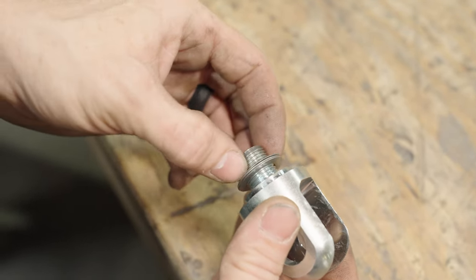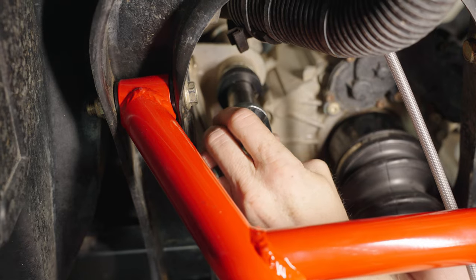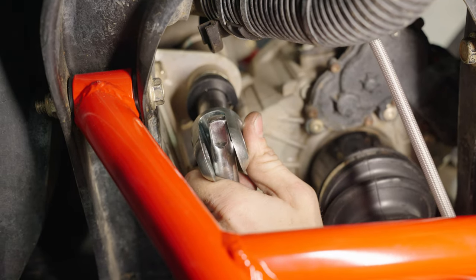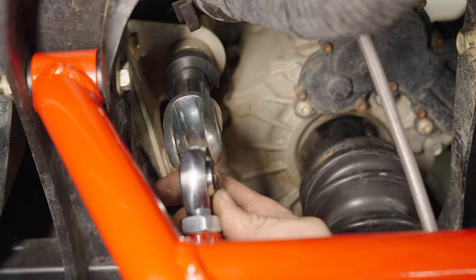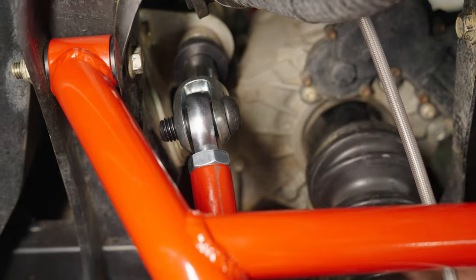It's likely that you'll need a different number and or combination of shims to get the proper alignment on the opposite side — that is a hundred percent normal. We're doing the same thing here: getting your clevis tightened down and on the same plane as the lower shock mount. Again, make sure your rack boot is pre-installed and insert your inner heim joint into the clevis and loosely hand thread the nut and bolt on.